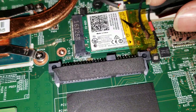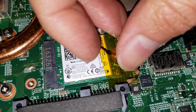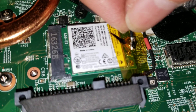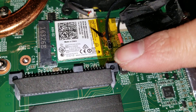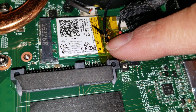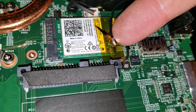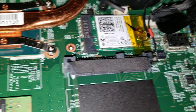For the wireless antennas, you have to move the tape out of the way. Like all the other models, you want to pull from the back of the antenna and then just pull it up. Don't try to pry from the front — if you pry from the front you can damage it. Just get as close to the tail of the metal piece of the connector and pull it up and it'll pop out.